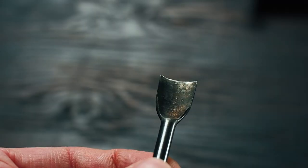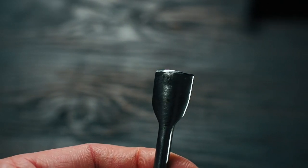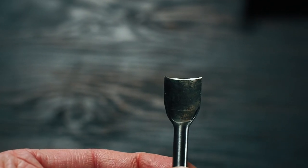One pointer I would give you if you are ordering these off Amazon is to make sure that you get a set that only has the bevel on the outside of the punch. Mine is beveled on the inside as well, and although that's okay for punching through a single layer of leather, it kind of slips off when I'm doing multiple layers of leather together, and just makes it so that I have more work to do when I'm sanding it down — I just have to clean up the edges a little bit more.